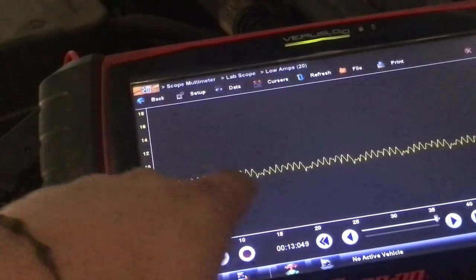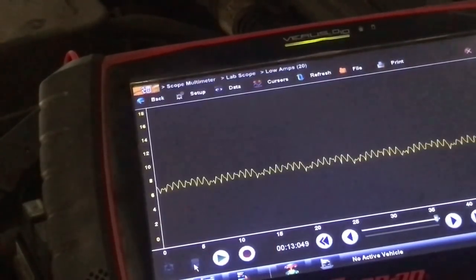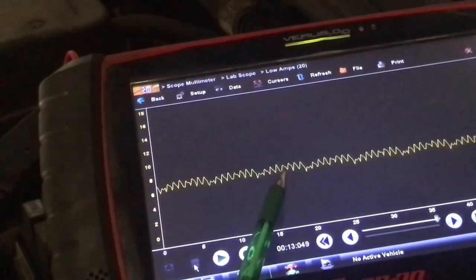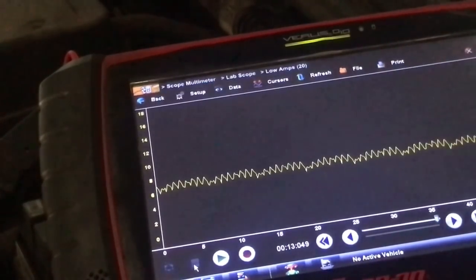Most likely right here, that's going to be the issue. That's where we're going to get the short out on this fuel pump, and that's why the fuse is blowing. And as you can see, there's another one that's about to go out right about there — this one has a small little drop. I'm going to make a video on how to remove this fuel pump for another video, but once I take the fuel pump out in this video, I'm going to try to open it up and show you where it's messed up. Let's get to it — we're going to the next scene, and I'm going to show you the inside of the fuel pump. Hopefully you can watch the other video where I show how to take off the fuel pump on this Equinox.